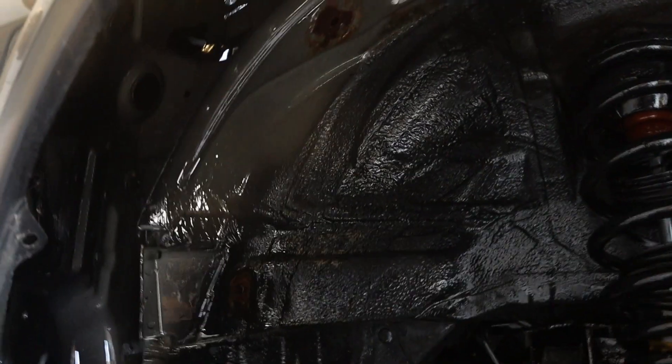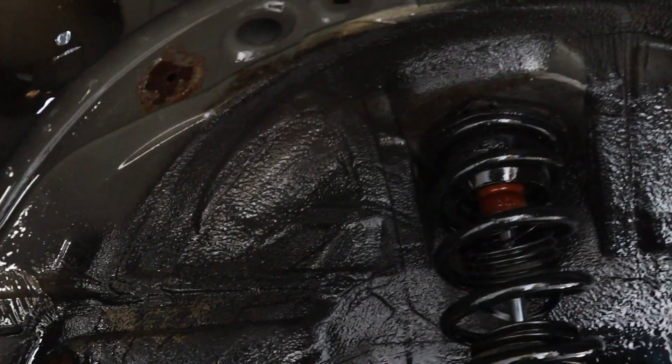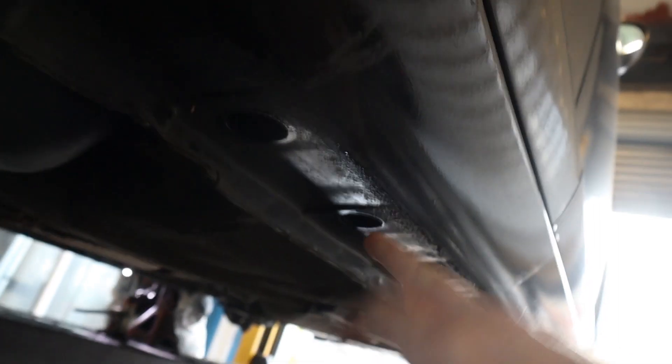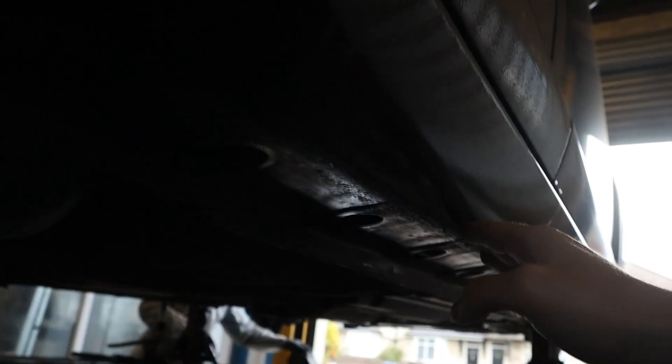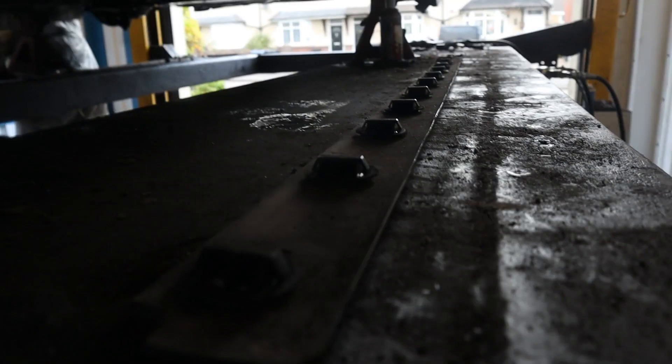It's going really well so far. I'm really happy with the car — happy that it is solid. Good to know that I'm putting the protection on before it's too late. Rob has just taken off the sill guard here, which gives brilliant access to all the little holes to squirt the sill and protect it. Normally these covers trap rain and muck and it rusts through there, but thankfully mine is very solid. It's a bit of a brutal process getting them off — he has to use a hammer — but he says he does about two RX-8s a week, so he knows how to do it without breaking clips.